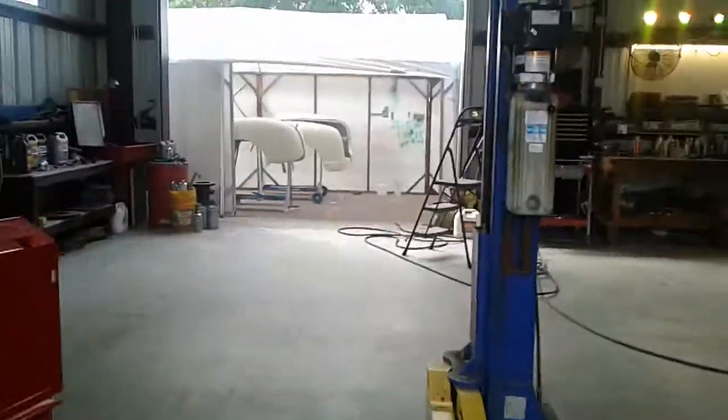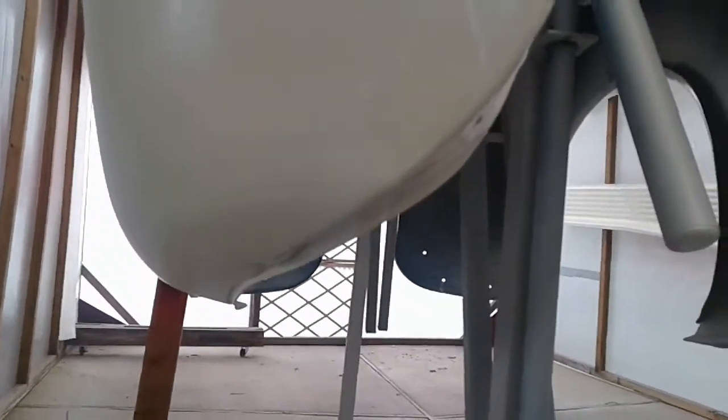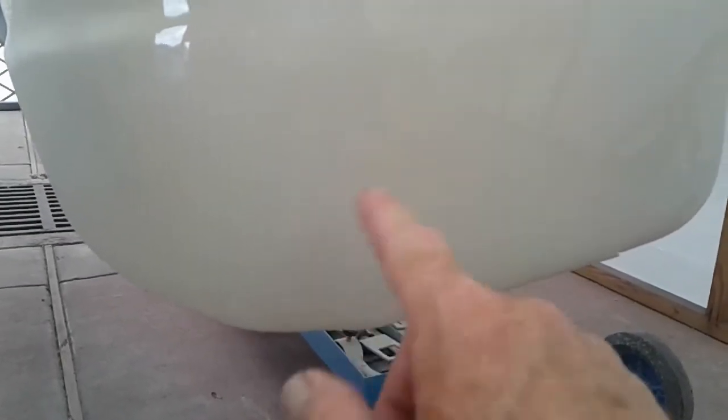The other thing I got done today — I'm happy to say — on this one I had a little repair to do where I burned through the edge right there on the bottom. I probably could have just touched that up with a paintbrush, but since I was having to repair anyway, I went ahead and hit that with a little white and gave it a clear coat. Same thing over here where I hit my air hose going across — got a little hanger there, but I'll run a razor blade over that and polish it right out.